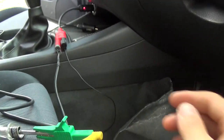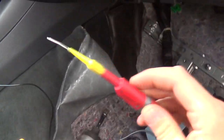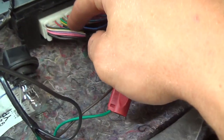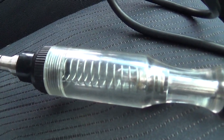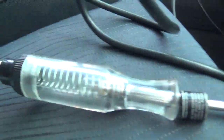The way I'm doing that is: I have a wire coming from battery positive through a 4-amp test light — I've only got two bulbs here, but it's 4 amps total. Then I'm going to touch the other end to pin 30 right here — it's the second one down. Now, the other side at the PCM, that's pin C1, and I have that back-probed — that's going to go through our low-amp test light, which is about 250 milliamps. When I touch pin 30, this test light should light brightly. I could just use a jumper wire instead, but just in case, we only send 4 amps instead of 40.